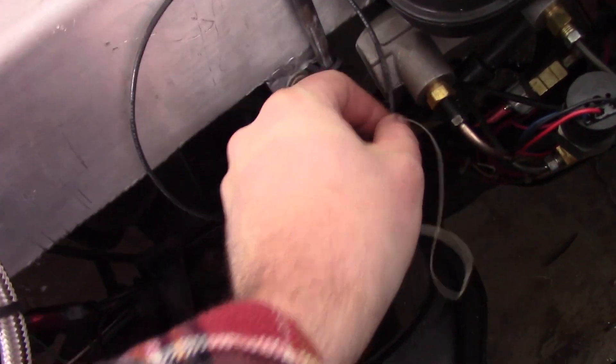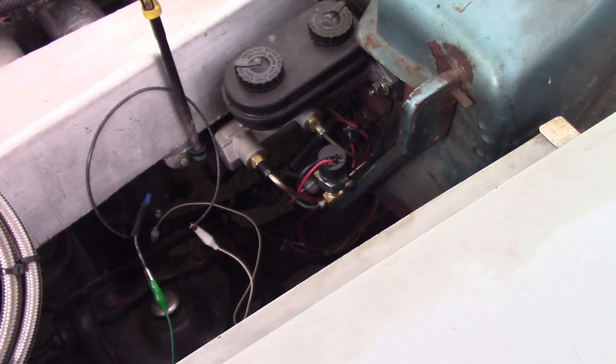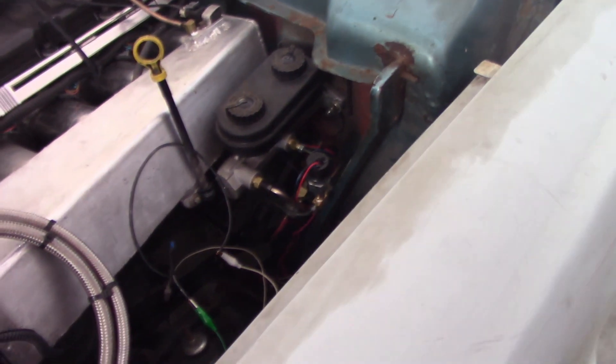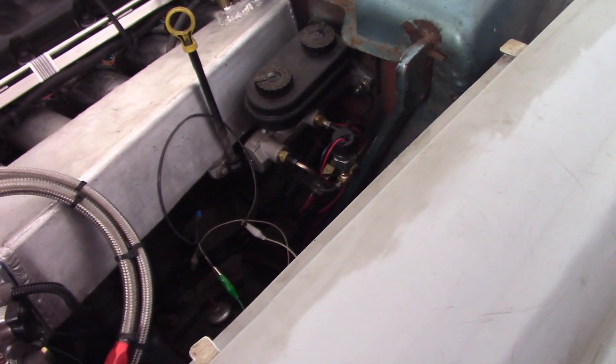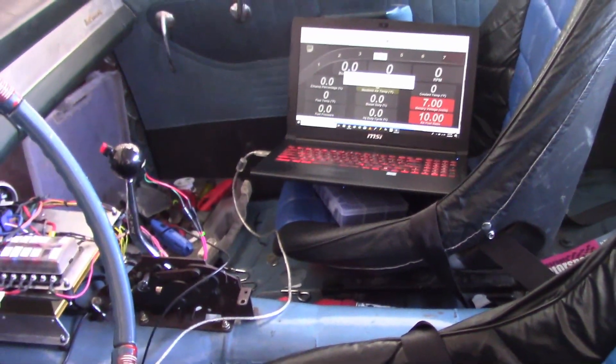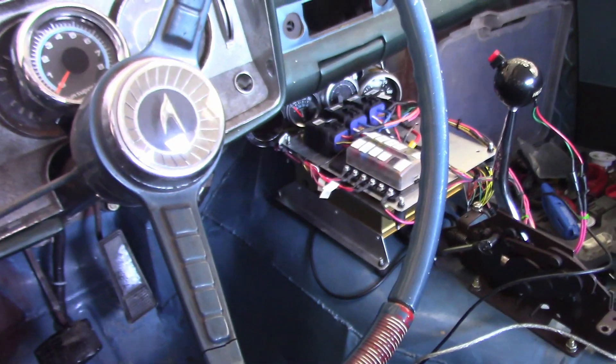I have to be really on the pedal for it to activate the two-step, and it also makes it release a lot better. Essentially this will release my two-step at a very high pedal position, and that will make the car launch better. I'll pull up to the line, hit the brakes really hard, floor it, and then wait for the Christmas tree to come down. It'll build some boost, and then I'll launch. And that'll be configurable — I can change my two-step up and down with my computer, and hopefully not break any axles.